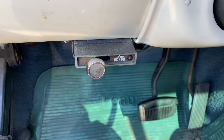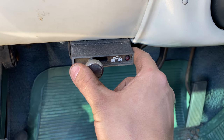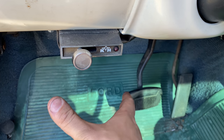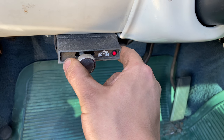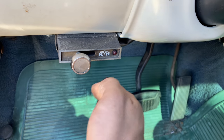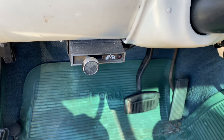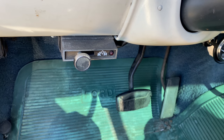You can also manually actuate the trailer brakes — you don't have to hit the brake pedal. If you're going down a hill and your trailer starts swaying, you can reach down and activate the trailer brakes manually and instead of it swaying it'll smooth and straighten back out. That's how that works. I love these old units, they're very cool.